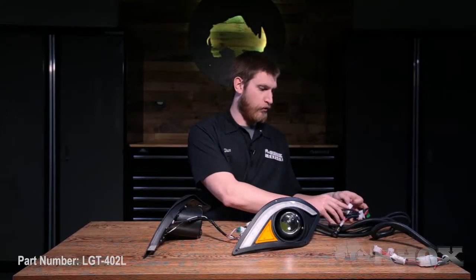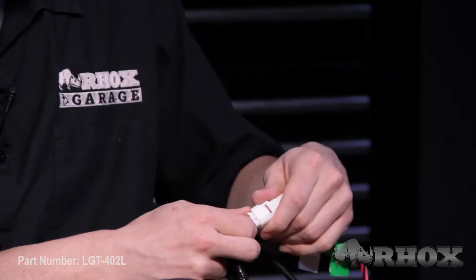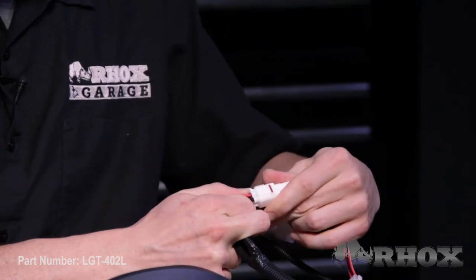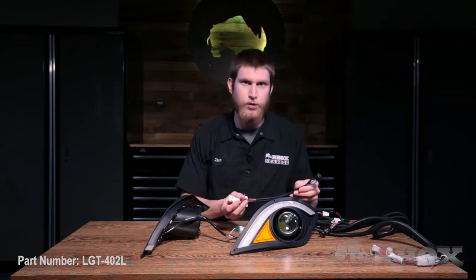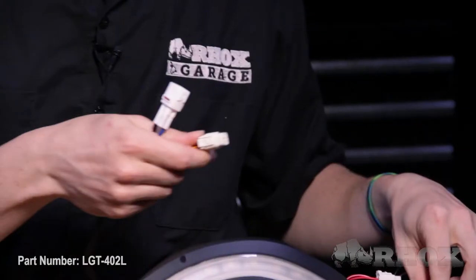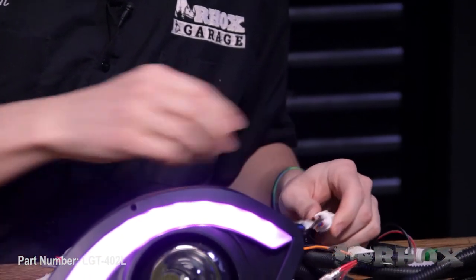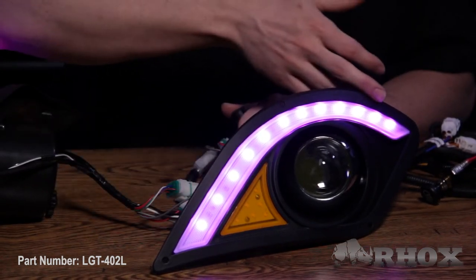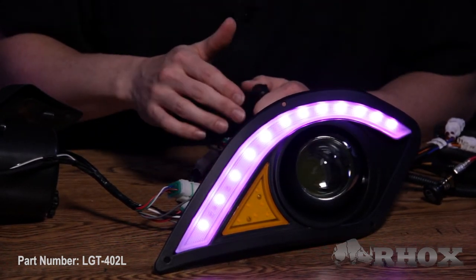I'm going to show you how we would connect the toggle switch if we wanted to add one. The LGT-331 is our toggle switch for this. As you noticed before when we were running through our harness, there was a connector on the harness. We're going to add the toggle switch in the middle of this — unplug it, press that down, push it down a little bit, and pull it out. Those are a tight seal; they are waterproof. We're going to add the LGT-331 right in the middle of that. With this toggle switch installed, this will allow us to have independent control of our accent lights — I can turn the accent light on and off completely independently of what the rest of the light kit does.